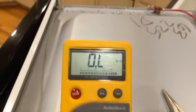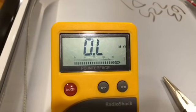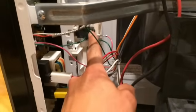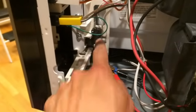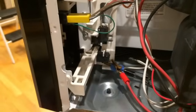Here's the second interlock switch. Both switches should be closed when the door closes. You can see the latches closing in here. Right now circuit is open, and when I close the door — as I suspected — it's not closing. Looking at the schematic, when you close the top switch it turns the oven light on; the bottom switch is what actually drives the magnetron and the turntable motor. So this is the switch that needs to be replaced.